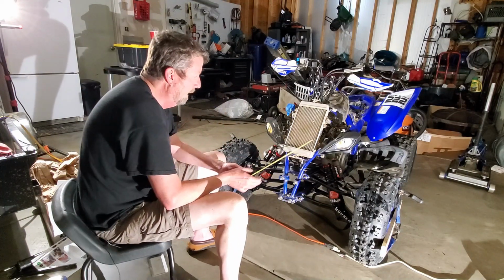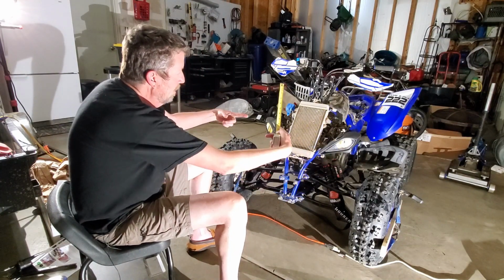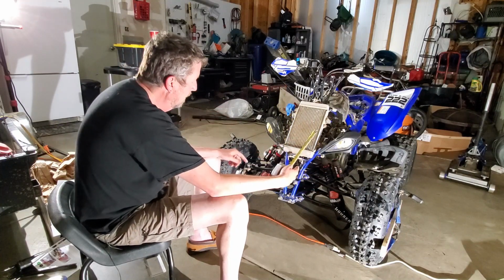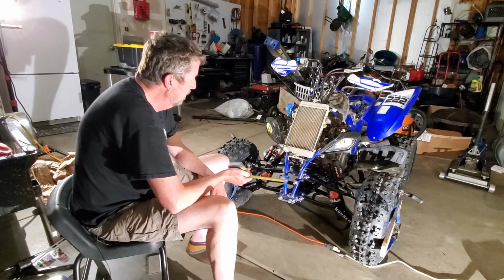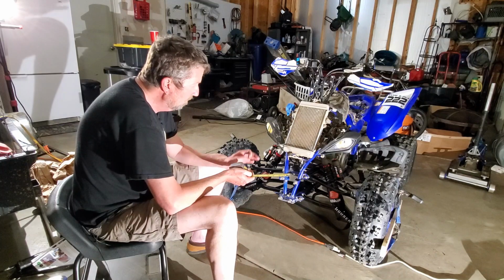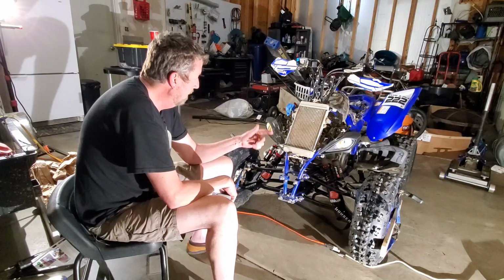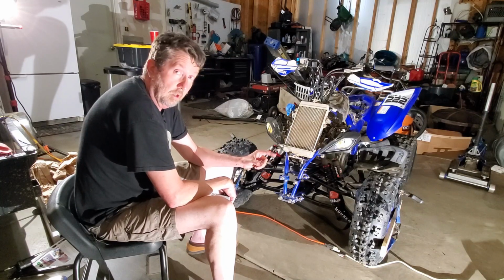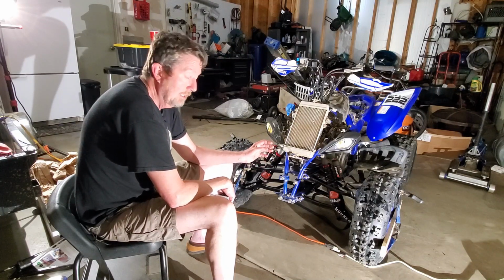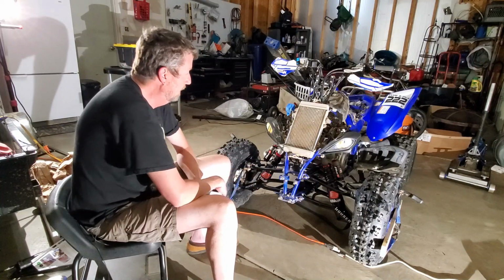But all you do on this thing again is if your wheels are too far toe in, you want to shorten your A-arms or your tie rods. That'll pull the back end in, the front out, and you just keep adjusting till you get them the same. Very, very fine adjustments. If you make 1/2 a turn on both sides, I didn't really measure it, but it moves it a long ways, a lot longer than you think of. I was trying to get in 1/4 inch. I'm not even 1/2 a turn. I'm like, a couple degrees is what's making the adjustments on this thing.